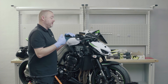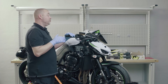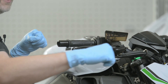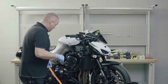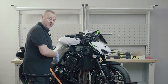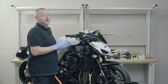It's also important — though not really an issue on this motorcycle as there's very little fairing — to ensure that when putting a radial master cylinder on, you have enough space to mount it lock-to-lock without making contact with the fairing. The HC1 is an extremely compact master cylinder and you're very unlikely to have a problem with space, but it's always one of the first things you check before you put it on the motorcycle.